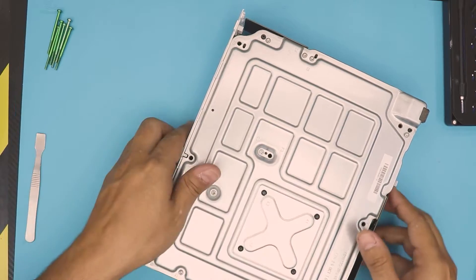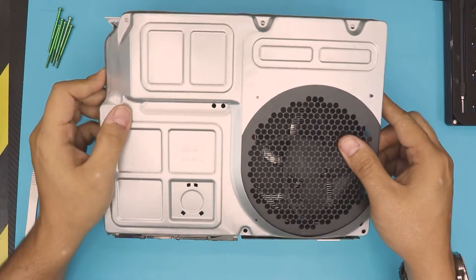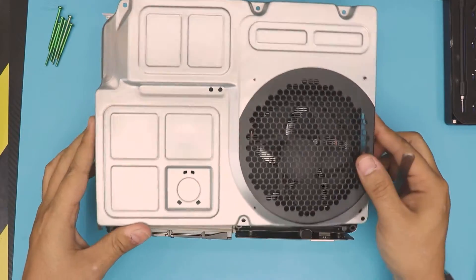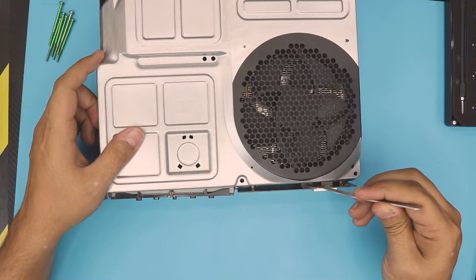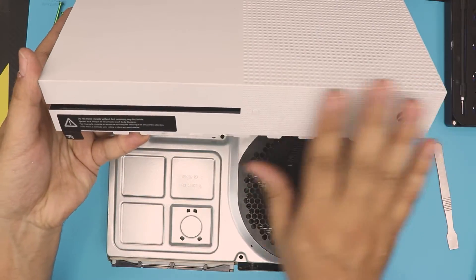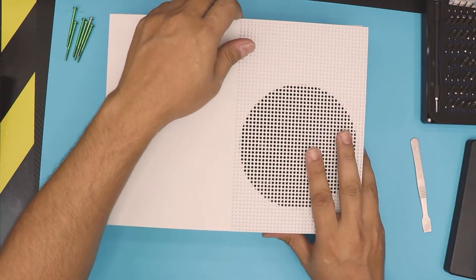Once that's done, put it face up, grab the top metal chassis, and place it on top. When putting it on, be careful not to squish the foam piece — put this side down first and pull the foam piece out carefully, then the rest sits on top. Once in position, grab the top cover, put the front end in first all the way down towards the table, slide it inward, and go all the way back.